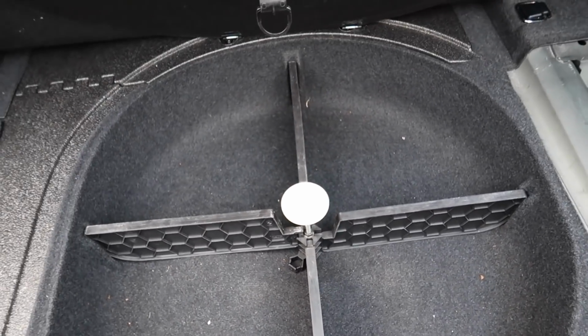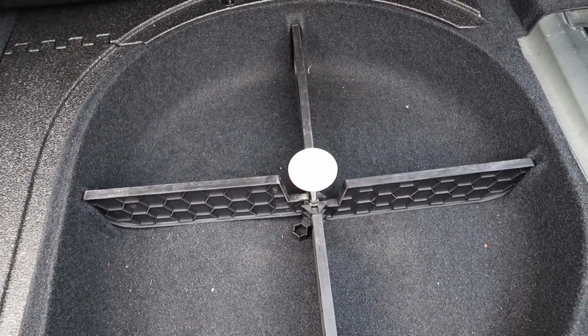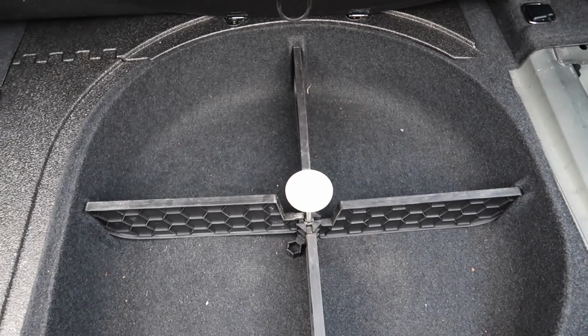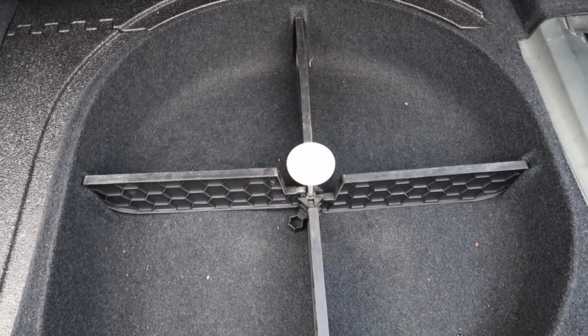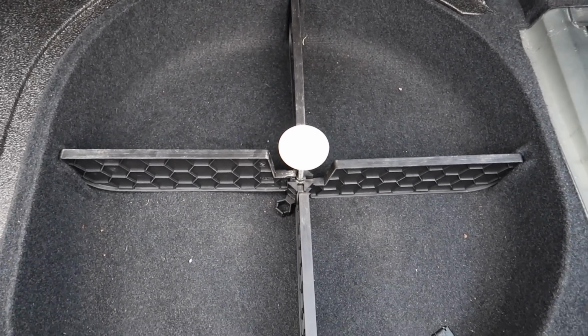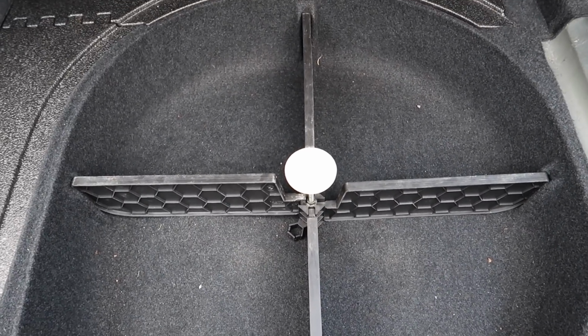A lot of people buying an E60 don't realise their modules are underneath there because nobody tells anyone. Then what ends up happening, they come to the channel saying that their car isn't working perfectly, and it's not their fault, just nobody told them. Where the dealers left it sitting outside for so long, water's then got in the boot and killed off the electronics and all the modules underneath there. The PDC module will be underneath there, micro power module, move them all, and relocate them as per my video. Guys, it's another common failure, and the micro power module isn't cheap.